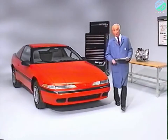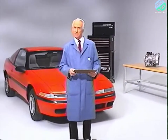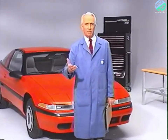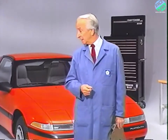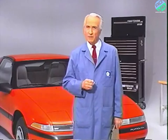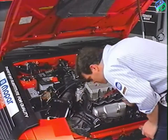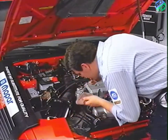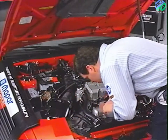The customer's vehicle is having a problem with second gear. Seems that the 1-2 shift slips and the engine runs up or races during the 1-2 shift. All other shifts are okay. This diagnosis will cover the broader approach — what are all the possible factors which could cause this problem. Keep in mind that the Laser and the Summit utilize identical diagnostic procedures. Perform a road test to verify the customer's complaint, then perform the visual checks as previously mentioned. As part of the visual inspection, check the level and condition of the fluid. If it's clean, the problem is likely to lay in the electronics, which may be indicated by a fault code.